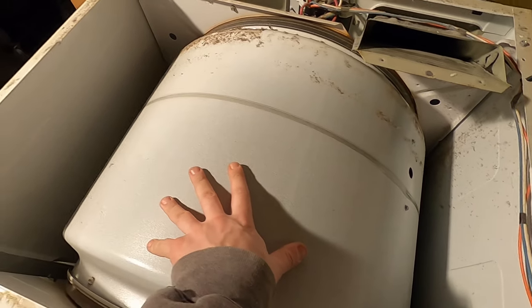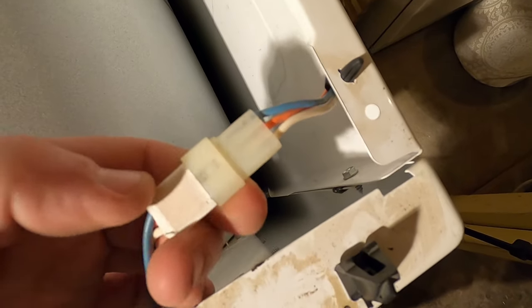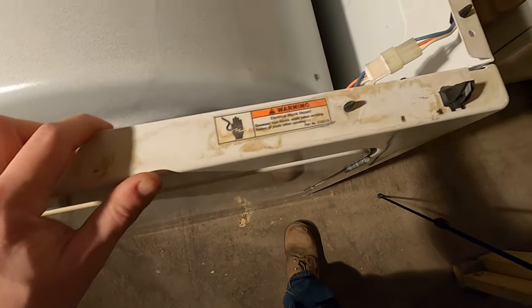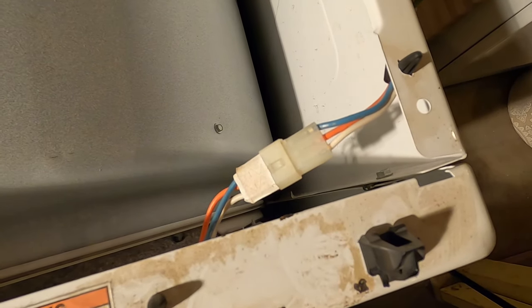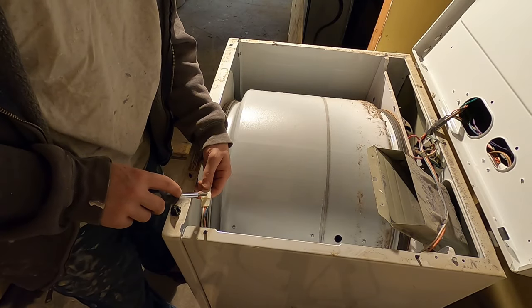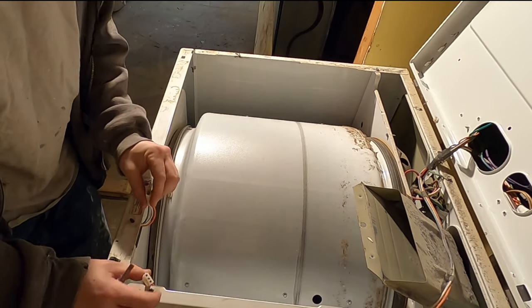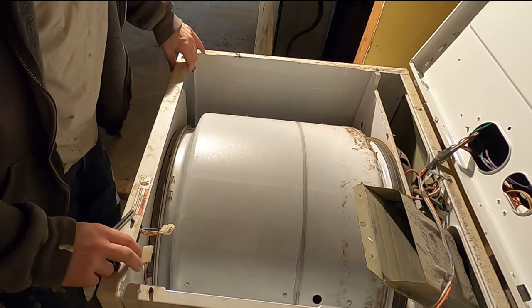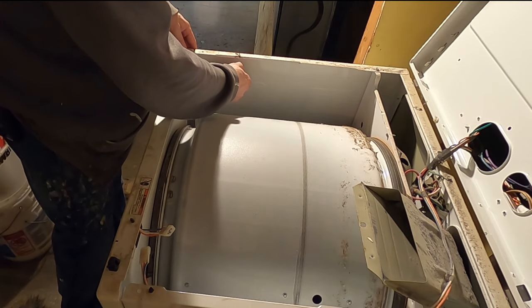So the belt's probably broken. Now we know we have to get to the motor, which is underneath the drum, so we have to figure out a way to do that. Just look around for fasteners of any kind — I see one right here and then another one on the other side. Also, when you take this off — we're going to take this whole face off — make sure you disconnect connectors like this. I'm going to start with disconnecting this wire, wiggle it off. For me these are 5/16ths bolts.